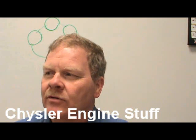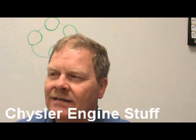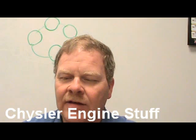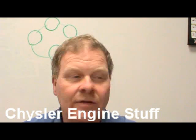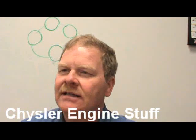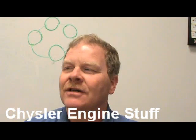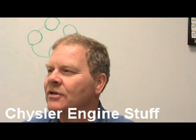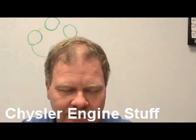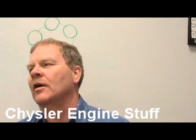So what we did was we got an old 9/16 socket, and we ground it around the outside to make it a little bit thinner, and drove that thing on there real hard, and we managed to break them loose and get them out of there. You just got to take every situation and use your gumption to get past these difficult situations. Because what we're all about here is solving problems, isn't it?